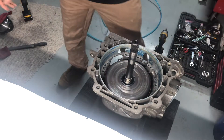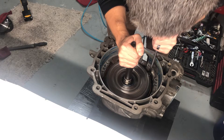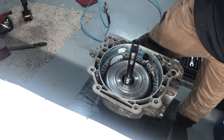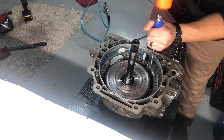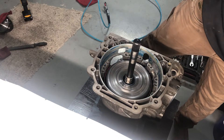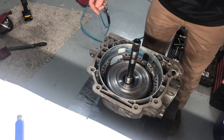Use a screwdriver to push down on that real quick because it's kind of sharp and can cut your fingers. Just do a little slight tap because it's only got like a couple thousandths of an inch to go - just like that. Your band is in.